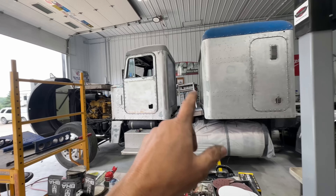Because I'm a beginner — well, I guess I'm not a freshman; I'm probably a sophomore painter because I did paint one truck already. After that, I'd have to put on at least two, three, possibly four coats of clear. That way I'll have lots of clear to wet sand and buff, lots of thickness there to try and get it as flat as possible and get this thing just looking like glass. So that's the plan — at least 10 coats of paint on this truck.